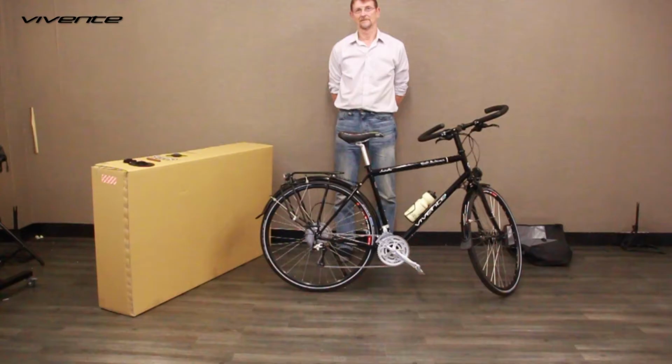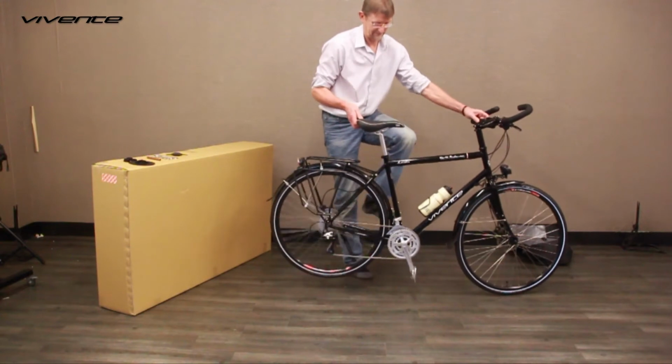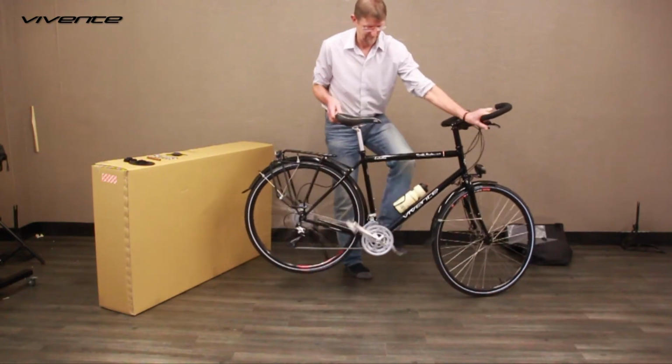First up, in the case of derailleur bikes, is getting the chain on the inside cogs. The rear derailleur is a point of vulnerability, so you want it in close to the back wheel. Turn the pedals and adjust both derailleurs so that the chain is on the big cog at the back and the small cog at the front.